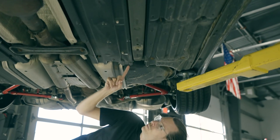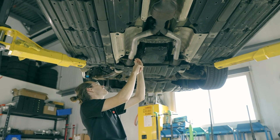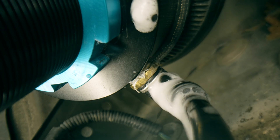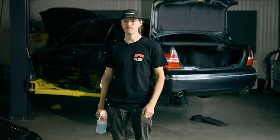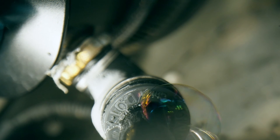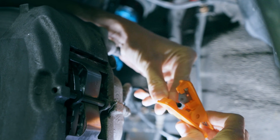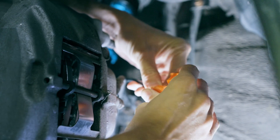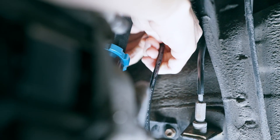The airline, due to poor routing, could potentially come into contact with something hot like the exhaust or a moving component that would pinch it. We got it — the nylon airline is leaking right at the PTC fitting, which is probably caused by the grasp ring. This has probably been unhooked and reconnected several times, and that can cause a marring ring on the line, which over time can be a point of leak. Your best bet is to take your line cutter included in any of these bag riders kits, cut right past that marring mark so it's gone. Now you can reconnect it, reinflate that bag, spray it with your soapy water again to verify everything's good, and then you're set.